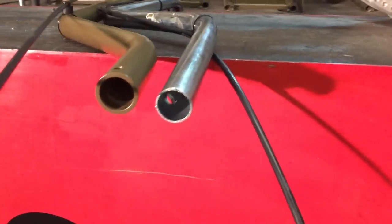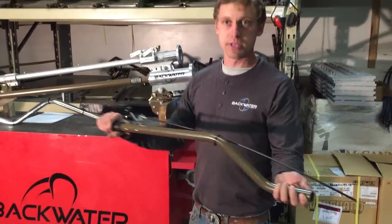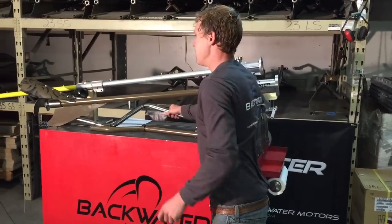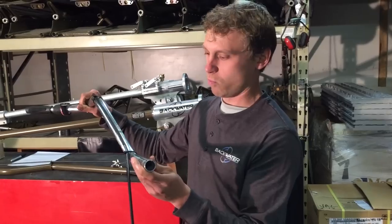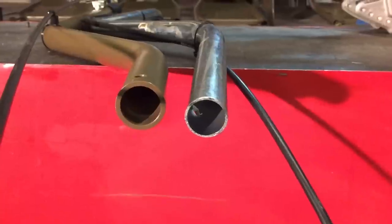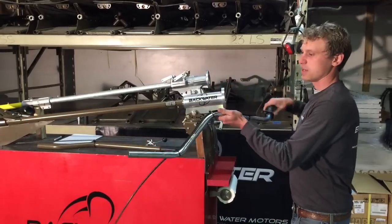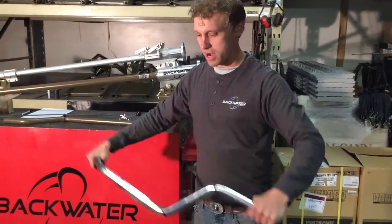Long tails do take some torque when you're stuck, that sort of thing. You might need to use this handle for some strong leverage. On this import kit, it's built out of what to me looks even thinner than conduit steel. With the length of the shaft and the torque that's going to be on here, I believe this handle is going to bend right in half.